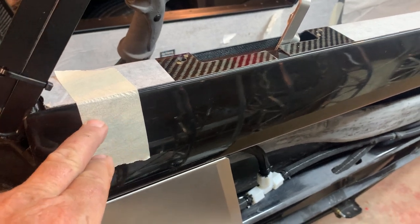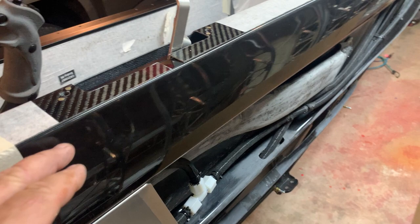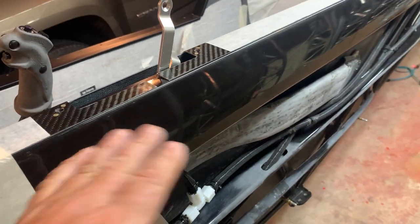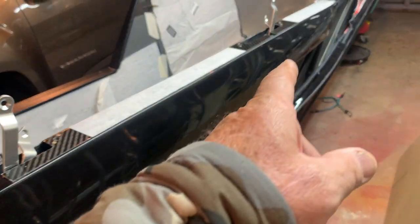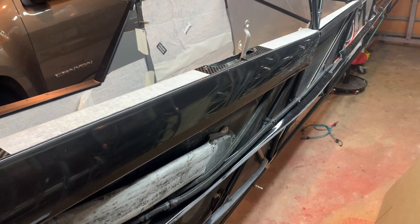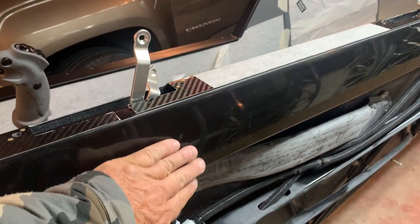when you put a glue line like that, this is a pre-glue, so they want you to put a tape down there, pre-glue it, let it dry, and later when you bring the fabric up, run MEK across it to activate it. But I don't know why you do that. It's always a nasty looking line. You can kind of see where that glue is under the fabric later, under the paint and everything. It just doesn't look the same.